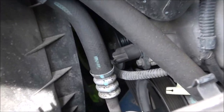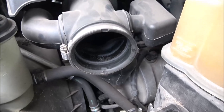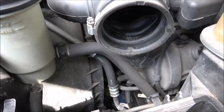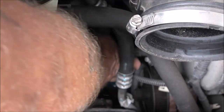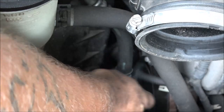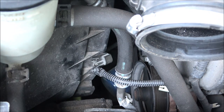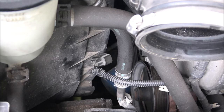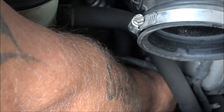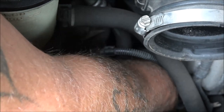There it is, right there — center of the screen, that's it. I'm going to grab a wrench. Here's the plug — right on the end of the plug there's a clip; you push it in and pull to unplug. It is an 8mm, and 5/16ths would work on it. I know you can't see much — I'm sorry — right now I'm going by feel.